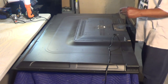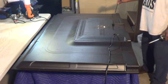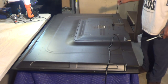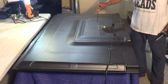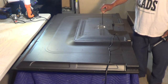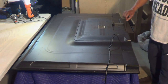I've laid the TV down flat. First thing we want to do is take off the stand. There are about six screws and three pieces — one piece on each side and a big inner piece. We have to remove the two side pieces first, then the inner back cover to get to the circuit boards. Be careful to separate your screws — there are metal screws, plastic screws, and longer screws at the very bottom.